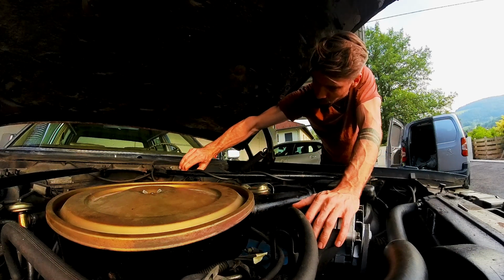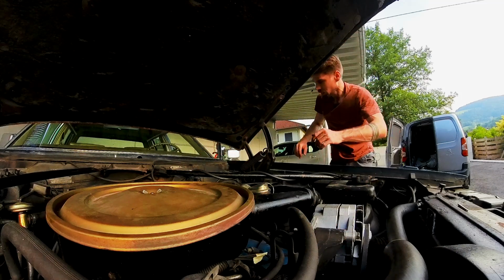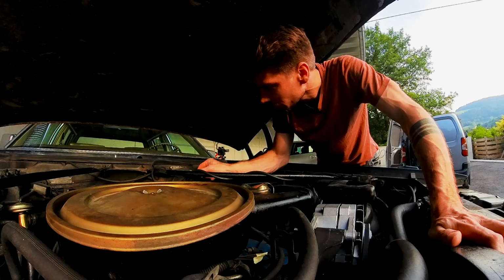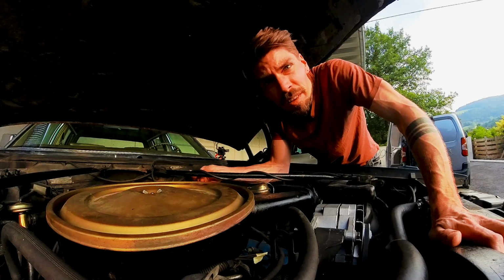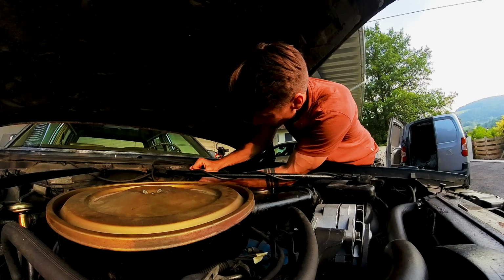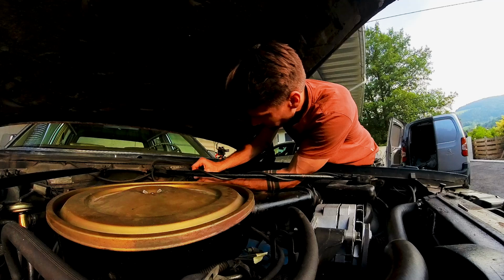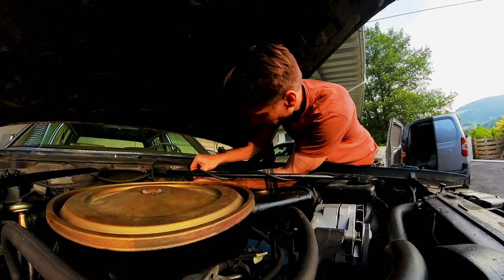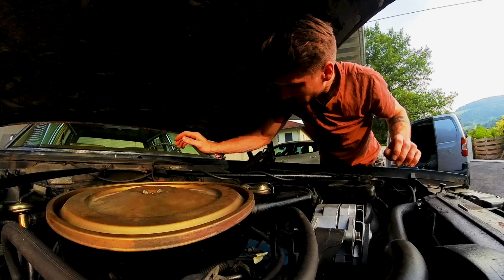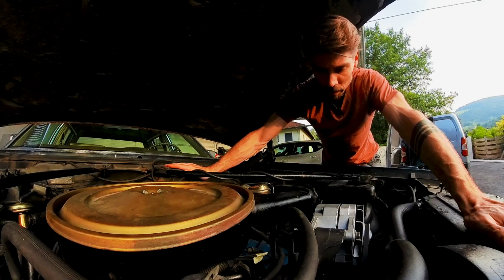So while I'm here, why not test this real quick? The windshield washer pump. Pull this out. Main switch on. Still 0.86, so this did nothing. Nope. Let's try that connection here. Nope. Not that noteworthy. 0.85, 0.86 still. So we know that this doesn't cause it as well.